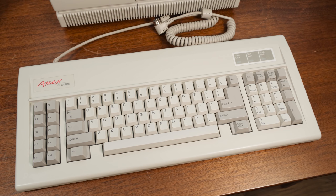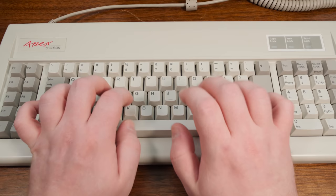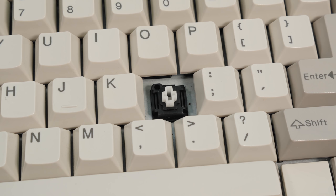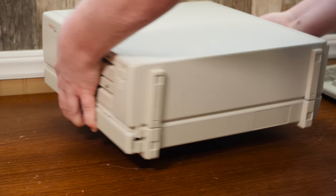The thoughtful design continues on the keyboard itself, which is an 84-key board with the layout mimicking the IBM AT Model F instead of the XT Model F. It doesn't feature the capacitive buckling springs of its IBM counterparts, but it does use white SMK inverse cross-mount switches using metal leaf contacts, with a tactile bump that's satisfying in its own right. I also quite like the way the angle adjustment legs work — you press down on the back half and pull upwards on the front, loudly clicking them into place.